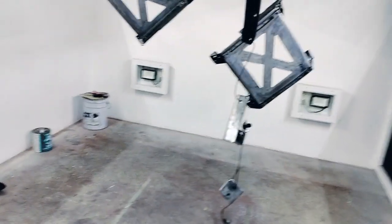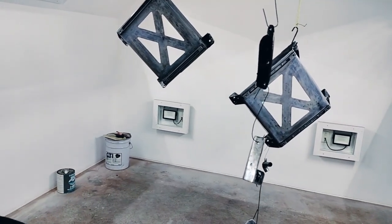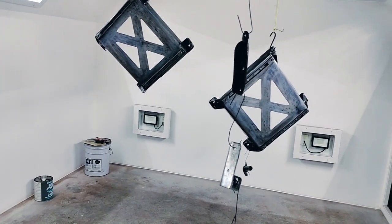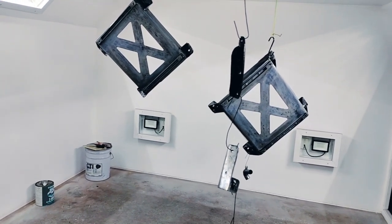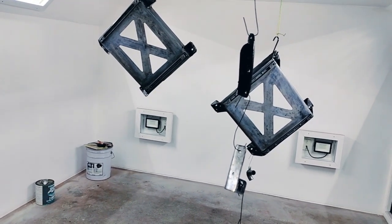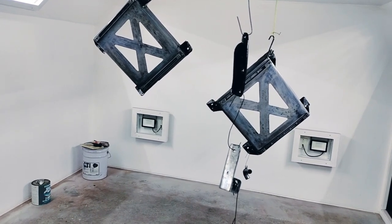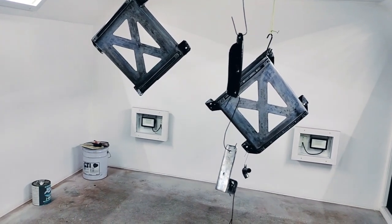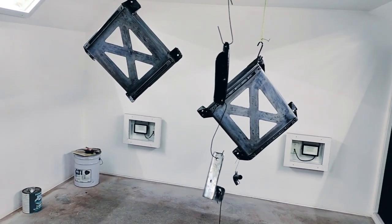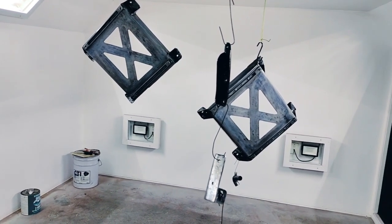So I'm just going to shoot this with an epoxy, a wet on wet epoxy that I use, and it's got a high zinc content, so it's a really good one. And then I can go straight over the top with a top coat. So just leave it about an hour or so for the epoxy to flash off, dry back a bit, and then go straight on to 2 coats of top coat. Yeah, and it should be good to go.